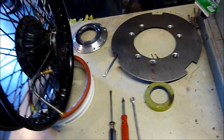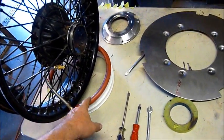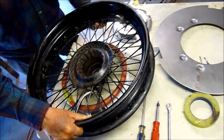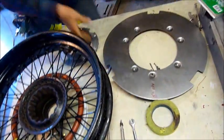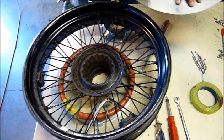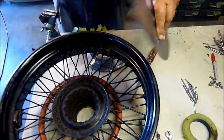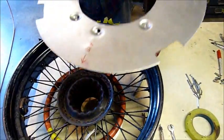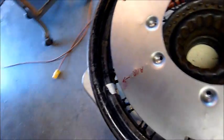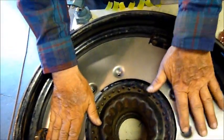Let's go ahead and put the wheel down on our five-gallon water bucket lid, putting the backside of the wheel up. We're going to engage the backing plate with the back of the wheel. Notice that there is a mark for an air hole on this particular one. Although the cutouts for the weights are non-symmetrical, that's not always the case. So we're lining up the air hole with the air hole in the outside of the rim, and in this case it meshes.